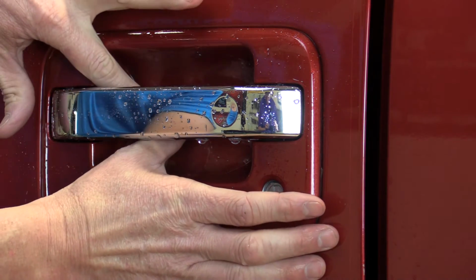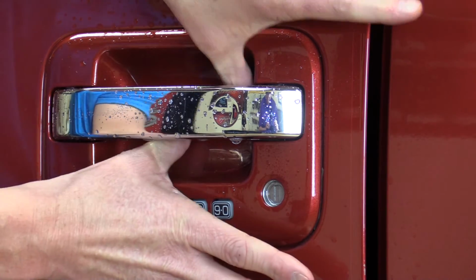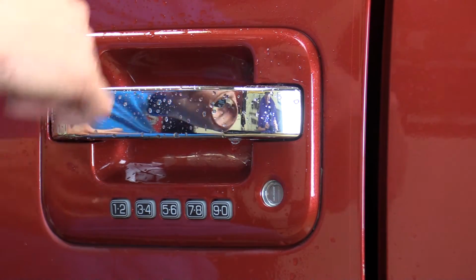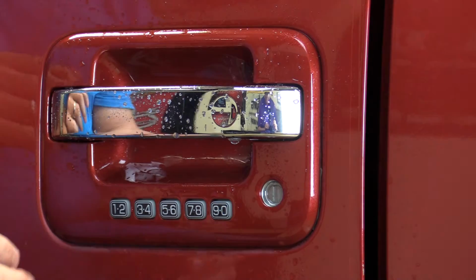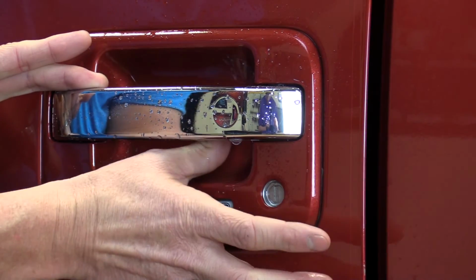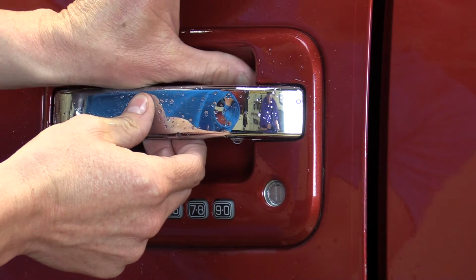What I like to do is take my thumb, and everything's from the center out. If you work from the center out, take your thumb and use it to push the moisture out. Maybe go down through the middle and up through the middle. That quarters the pattern and allows you to equally disperse the stretch from the center out. Where you get to these curves, that'll help you out. Take your thumb from the center out, pressing the moisture out of your pattern, the quarters that you've created.